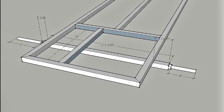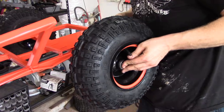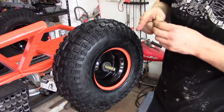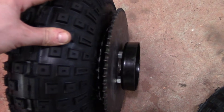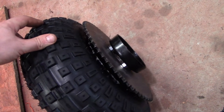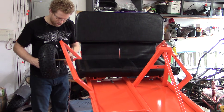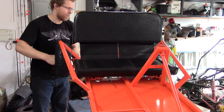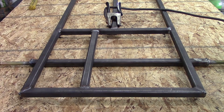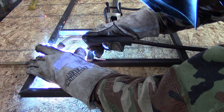On the left it's a six-inch bolt, and on the right it's a four-inch bolt. The reason the bolts are different sizes is because the drive wheel assembly is a little bit wider to support the sprocket and brake. The other wheel on the passenger side just free-spins, so it's not as wide and you don't have to worry about it.